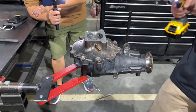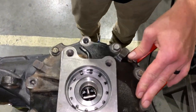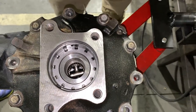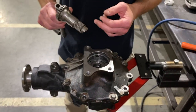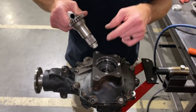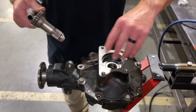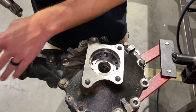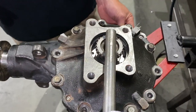With the Harrop, if you look down in there, you can see it has a four-way cross pin, which is very strong but makes it difficult to run a pattern. Our standard tool that locks around an ARB or stock open differential will go in, but because the Harrop has this four-way cross pin, it won't work for spinning the carrier. To actually get it to spin, I'm going to have to lock the e-locker in. Otherwise we'd just be rotating the spider gear and wouldn't get any resistance pressure for the pattern check.